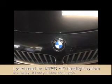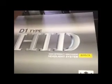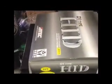This is my attempt at an installation video for a BMW Z4. I'm going to be converting the stock halogen lights that came with this 2007 Z4, and I'm going to be replacing them with a set of HID high intensity discharge headlights. These are the H7 bulbs, and the color I picked was the 6000 Kelvin. I liked it because it was the closest to what is standard on the BMW.